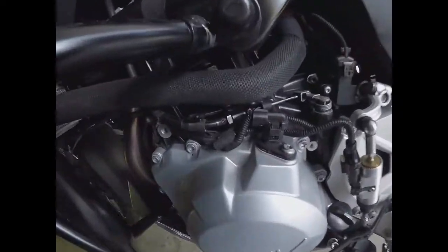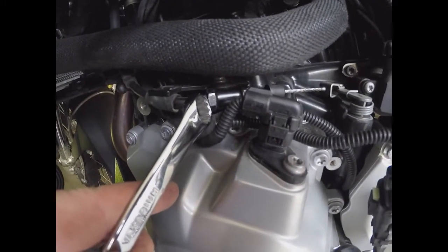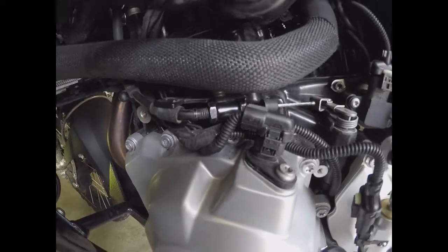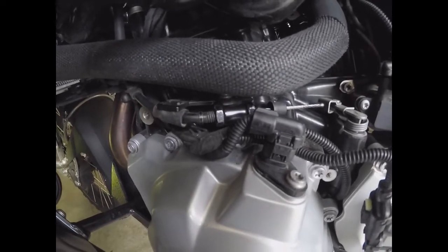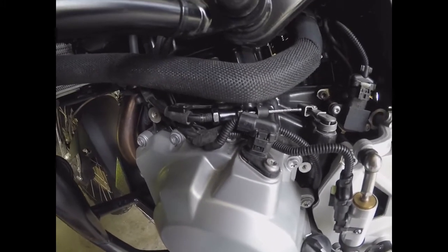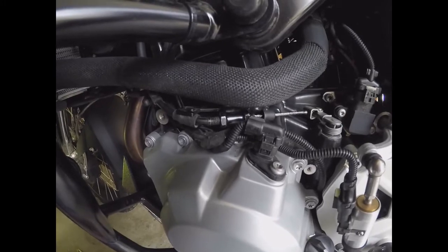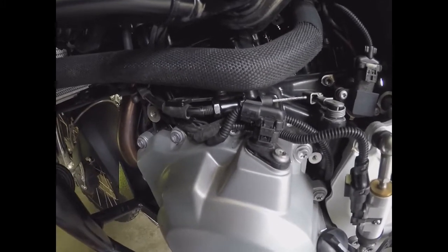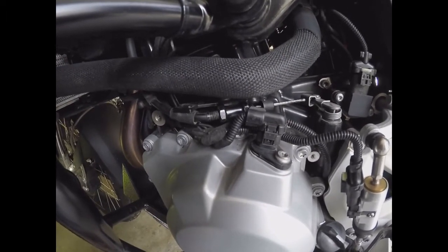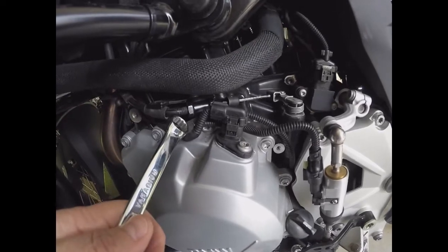So what I've done is I've come back down here to the inline adjuster, and I've retightened this nut here, which is effectively lengthening the line, and that's what's gotten me into the zone here. And I'm going to use this for the primary adjustment spot for getting me to not having too much, because I can actually still tighten the one that's up there. If it's too little, I can adjust that one by tightening, but I can't loosen it any further. So that's a bummer. I'm going to have to think about why that might be. It just is really jammed up, but only in one direction. So very odd. So anyway, I'm going to use this guy to do any further adjustments.